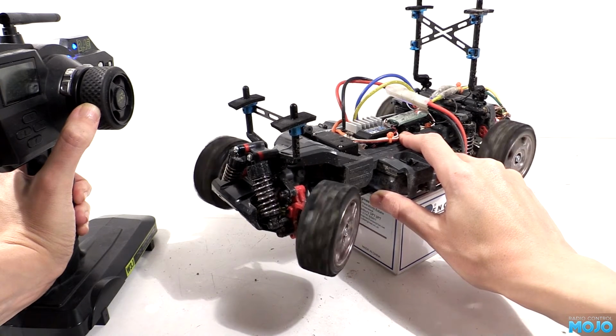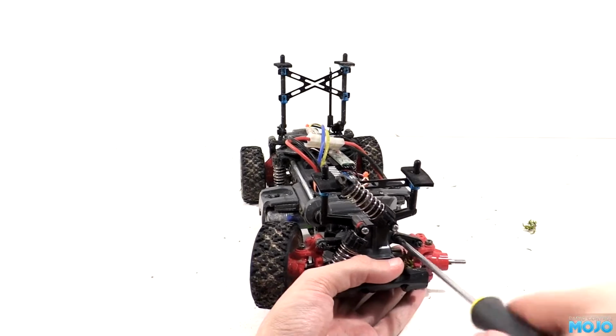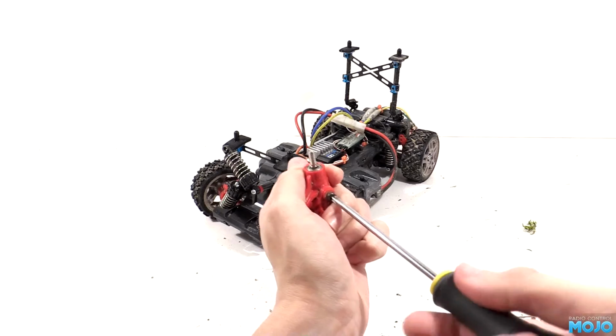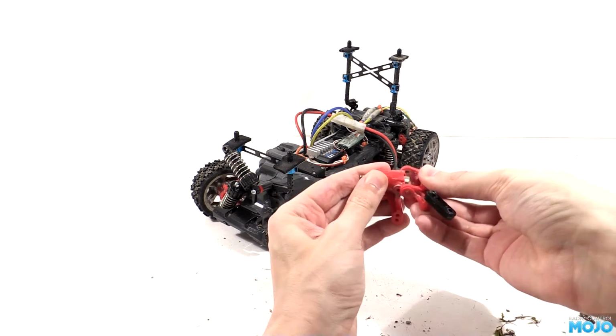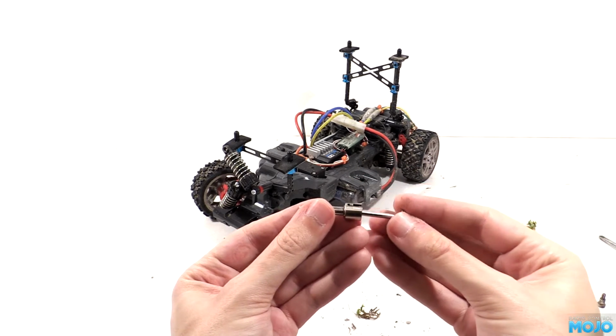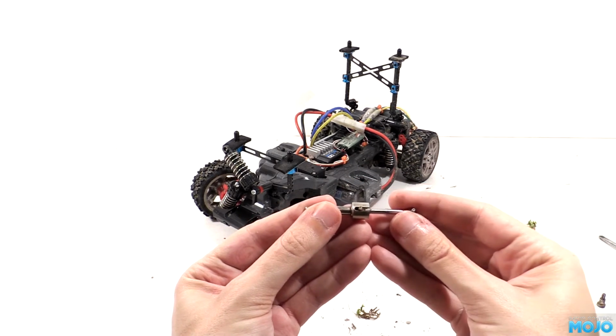You can hear the nice smooth sound of the running drivetrain start to stutter when we go to full lock with the steering. If we remove one of the hub assemblies, there's only a couple of screws to take out, and undo the kingpins we can get at the stub axle and driveshaft. As the suspension and steering move, the pin runs back and forth in its slot.